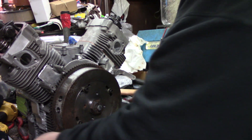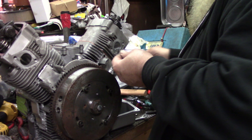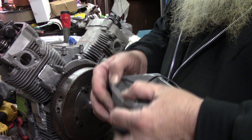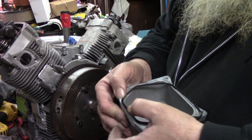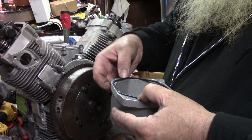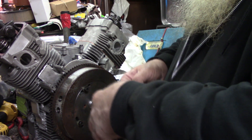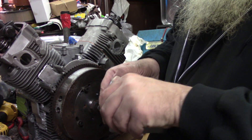These things take just a standard Kohler valve cover gasket. They are kind of shape matched — they got the angle on them. Now, when you put these in, you're gonna be tempted to just put it in and run your thumb over it. That's not what you want to do. Push it down in with your fingers all the way around. Don't slide your finger across them — if you slide your finger across you can stretch this gasket and then it will not seal right because it'll be bunched up in a corner or along a straight edge. You want it just to lay down in there nice and flat. Just keep working it. It takes a little bit to get them worked down in them little grooves, especially these ones.